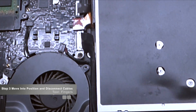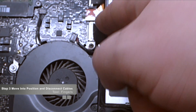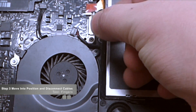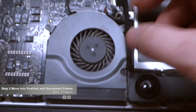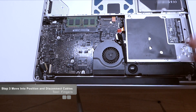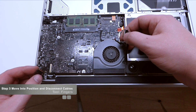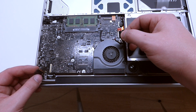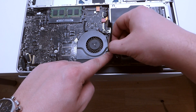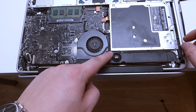The second thing we're going to unplug is right here near the CD-ROM drive. You're going to lift it up from the bottom, get your finger underneath there, pinch it, and then move it to the right. These two cables — the LVDS connector and this connector — are in charge of your network antenna, your network card, and your iSight camera. Once you remove this unit, you can trace it all the way down and gently pull it up and push it out of the way.